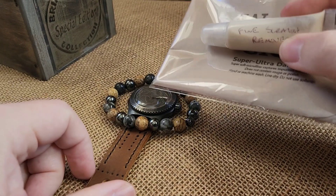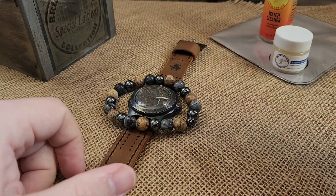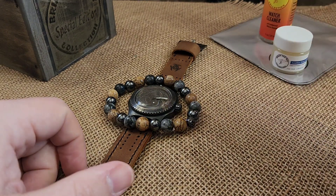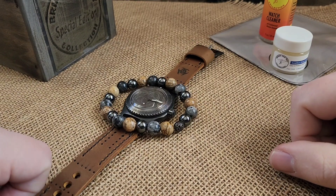If the scratch is up and down, go left and right, fill in that scratch, buff it, haze it out, see if it's still there. If it is, revisit it after this has solidified in 5-10 minutes. You don't want to remove what you've added in there when you're rebuilding up the acrylic. So that is the build.